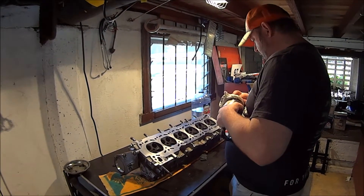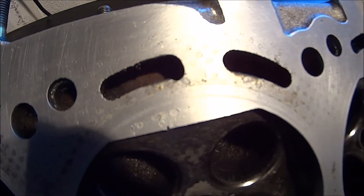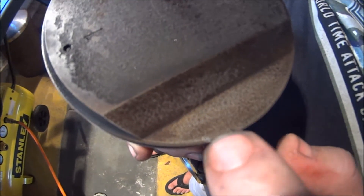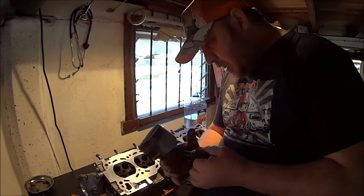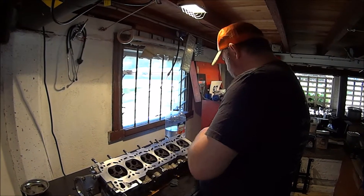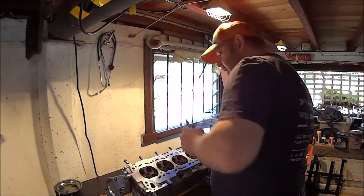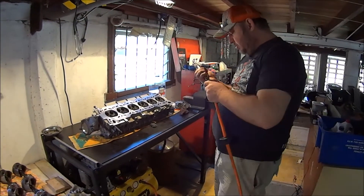So I've cleaned the head up pretty well - it's not perfect. Number 2 also has impact marks on here, very faintly, but it is there. We also have a faint couple of marks on the matching piston. So something has been sucked in through the engine at some point, or multiple things. It would make sense that it came through the intake somewhere. I don't know what it was, I don't know if it was still in there - I didn't see anything come out when I disassembled it. It's not a good thing. I still don't think that's the knock, but maybe it was.